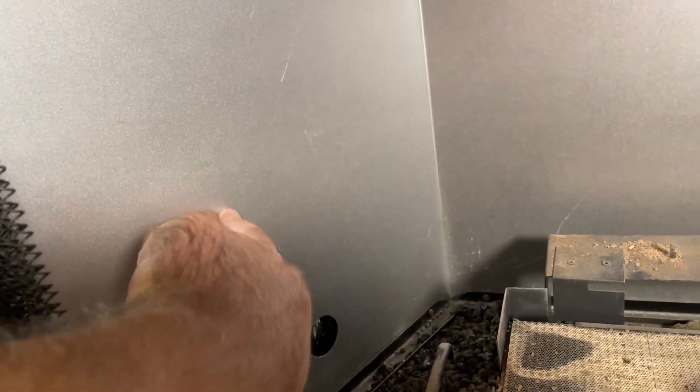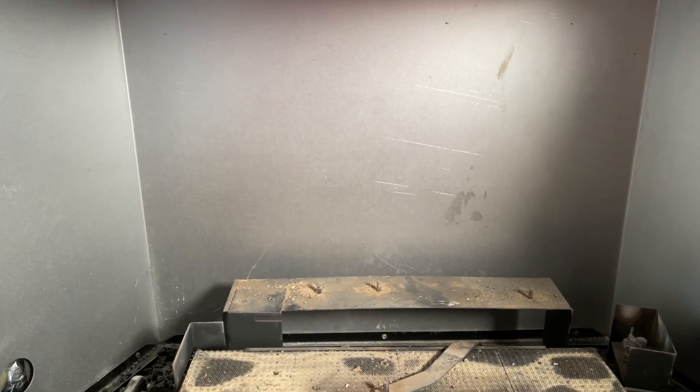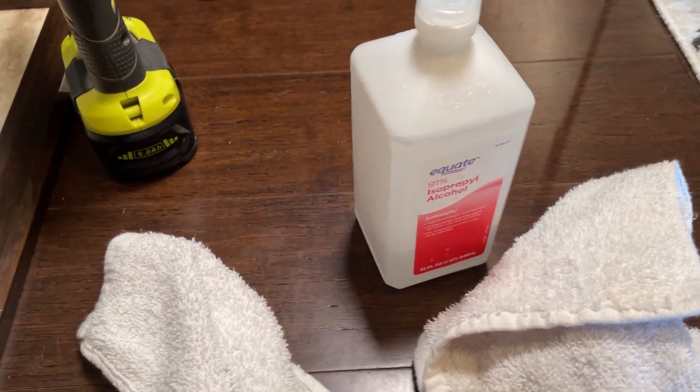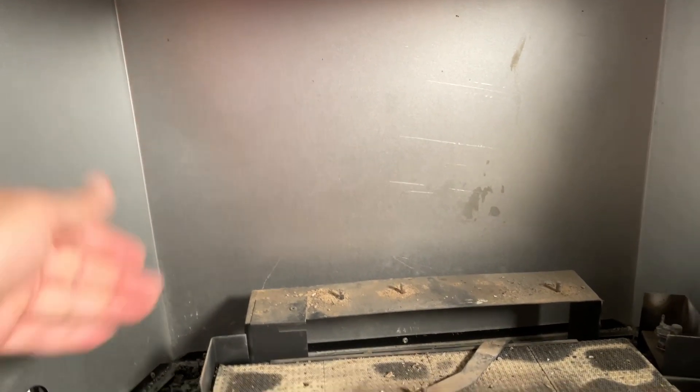Now you can get a real good look at what this thing actually is — just sheet metal. You can see why any amount of bass vibration in here quickly makes things loud and obnoxious. The only surface prep needed is a thorough cleaning and degreasing. You can't have any grime, grit, dust, or dirt. If the material starts to decouple from the surface, it may as well not be there. It has to be one with the sheet metal to act as one moving mass. So just wiping everything down with alcohol and a couple of rags.